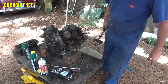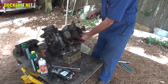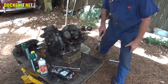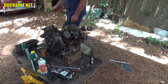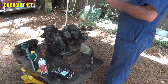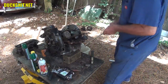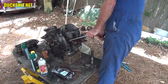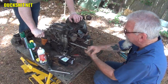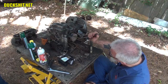It rolled out of the way — I don't want those in the grass, they'll give me a flat tire. What's the matter with the fastback? It won't start — not enough voltage to engage the solenoid; I can't even turn the headlights on. The dash lights all come on nice and bright. Check your battery cables. Fuel pump fired up but the starter will not engage. Headlights don't want to come on — might be something in the ignition switch. It might be spinning on the other side.